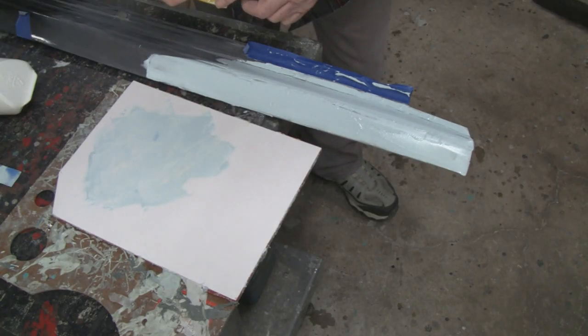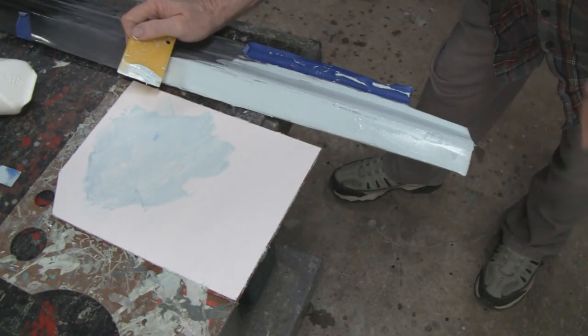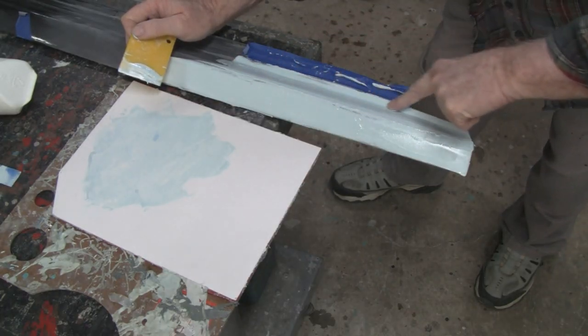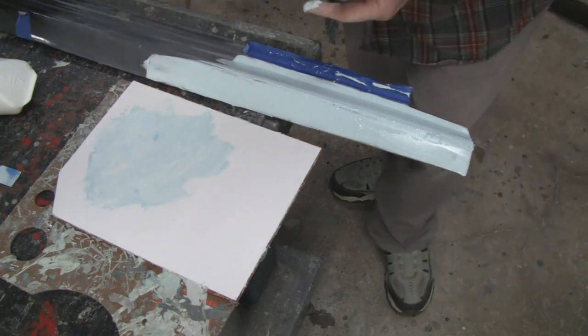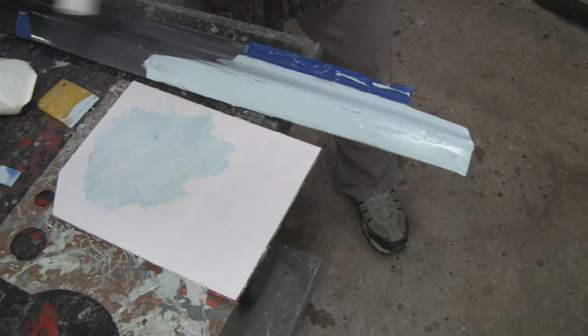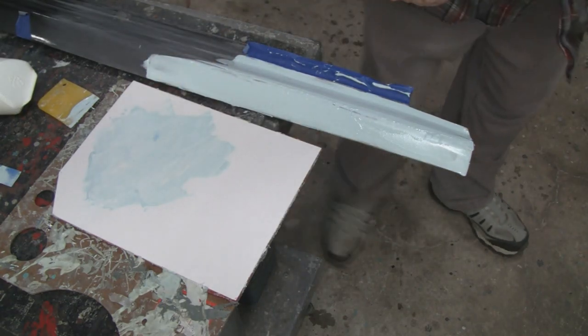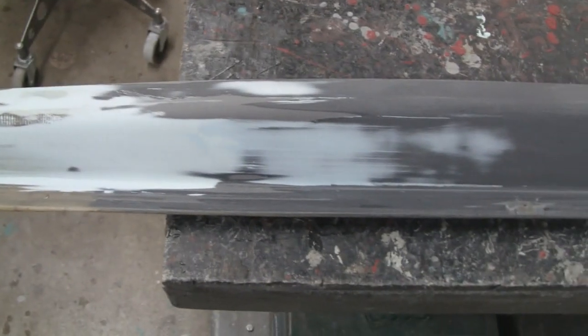Okay, we'll do a little crevice here. Here we go. All right, so we'll let that set up, and then we'll sand it with 120 or 220, and it'll be good to go. All right. We got the glazing putty all sanded down and it's smooth as glass now.